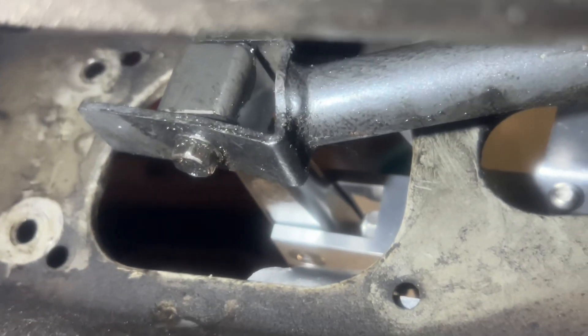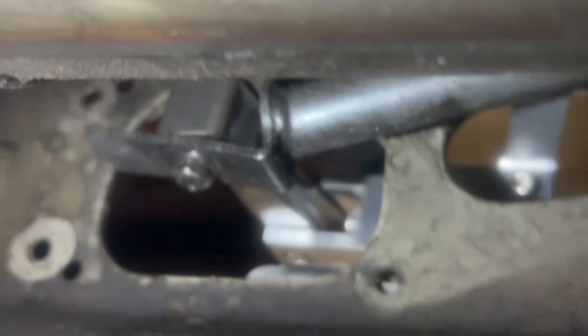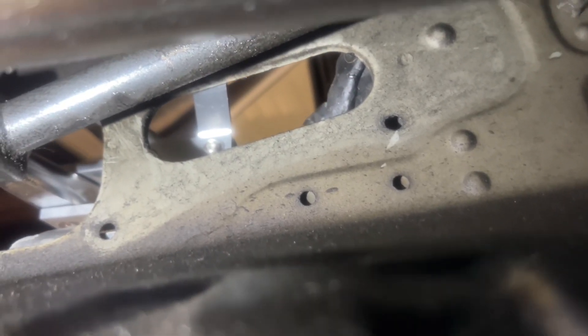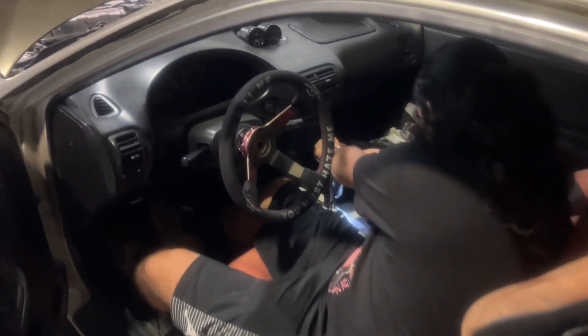You need to make sure you have washers in there once the bolt is on, because the washers will press against the bearing and let it shift smoothly. If not you're going to have a lot of binding issues. The linkage is on — bolt it up. Then we'll drill the holes, come back down, and that'll be it. We also need to tighten those bolts under the base plate — I forgot about those.